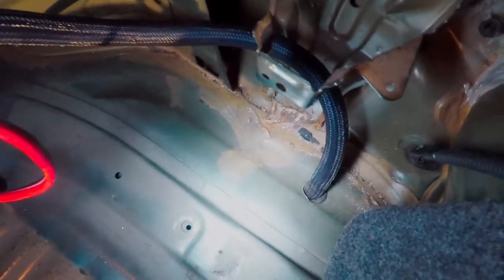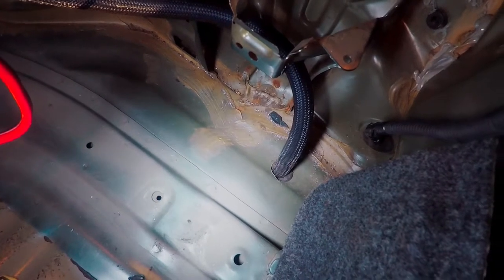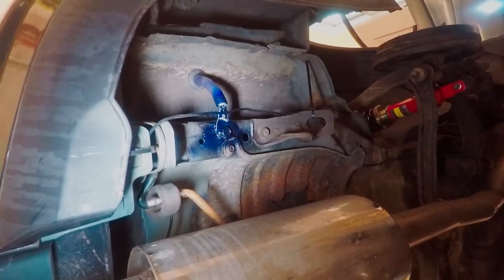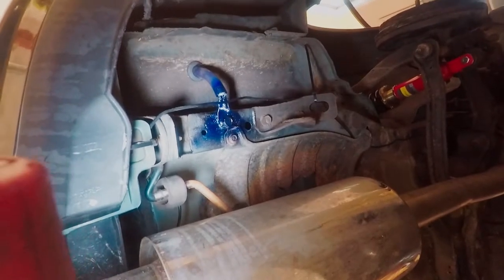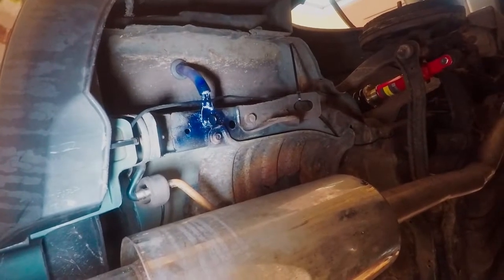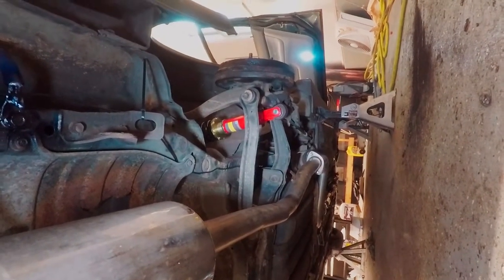For the ground I actually drilled a hole. I have a grommet there but it doesn't quite fit so I got to figure out something to keep the wire from chafing. If you look underneath here, this is where I have the ground cable. I used some battery sealer on it just to keep it from corroding, and I went right into the frame with a nice 14 millimeter bolt and big ring terminal. That's definitely going to give us a solid ground for our battery. I also got the other strut coilover set up and tightened down.